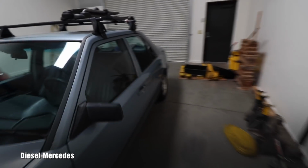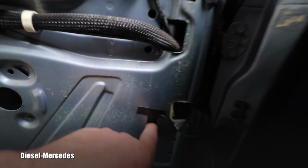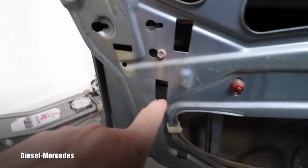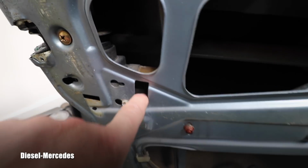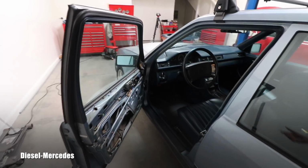And to explain what I mean that it's hooking on the door, I will show it. This is the inside of the door. We fixed the door check. And these are the holes. These are the places where those hooks go inside. You see it here, see it there. This is another one, here, here, and here. This is the top one. So I can see how wide it is. And basically this is the way you install the door panel. It goes down there. By the way, don't you love this sound?